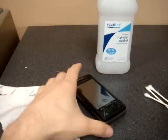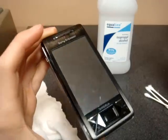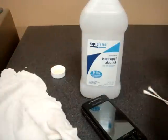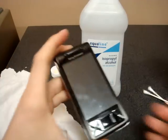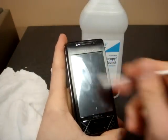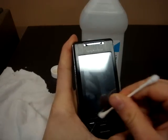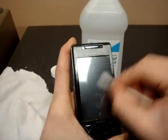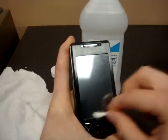The first thing that I do is blow off the surface dust and debris — there is a little bit, so I try to get around the screen and around the buttons. The next thing I do is get a Q-tip and dip it slightly into the alcohol, but I don't want to get it too wet, just kind of damp. So I dip it in and shake it out because we don't want a lot of moisture here. Now I'm going to take the Q-tip and rub it around the screen, and then go back into the edges at the corners of the screen where a lot of pocket lint and dirt kind of accumulates. There's a little smudge down here so you can work a little harder on that, and when we agitate it in a moment we'll get more of that off.